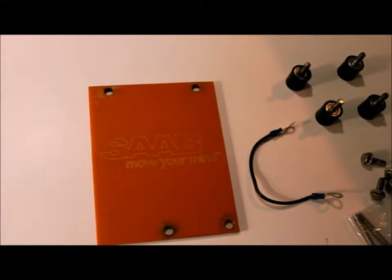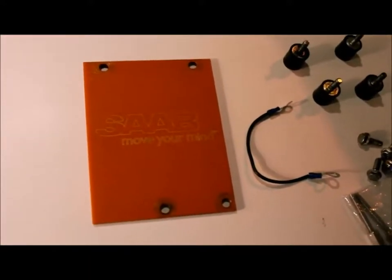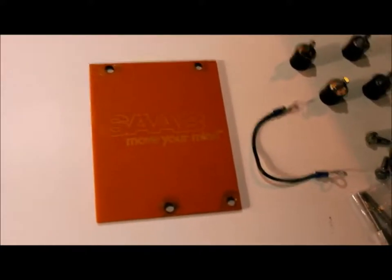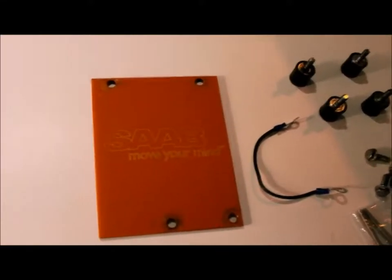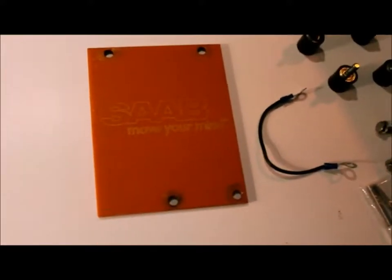Other than the navigation missing, it's a good car — he kept up with it, everything was working pretty well. But this ECU problem is just frustrating. It's a good car, it's just too bad that I'm up against big GM, who seemingly made every effort to make this car a pile of junk while Saab was trying to make it the best car ever. Those opposing forces are why you end up with an ECU mounted to your exhaust manifold, and why people are making aftermarket spacer kits for it.